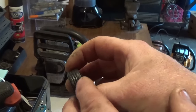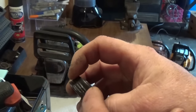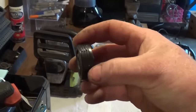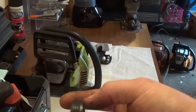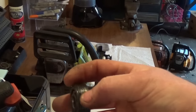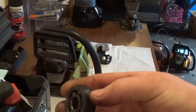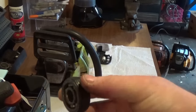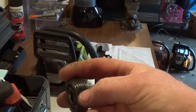And if you see right here, you'll see there's actually a deformed spot on this seal — there's one here, as well as right here. And of course when the seal deforms, or gets warm if you will, you can even see where it has gotten really warm. It should have a real uniform look to it, like this. But as you can see, the saw had been really hot, and where they're compressed together between the cylinder and the base plate, they basically will deform like this.